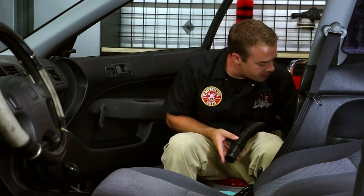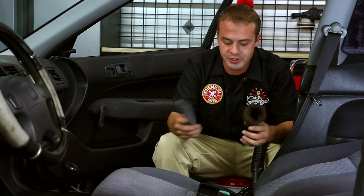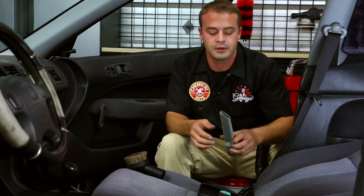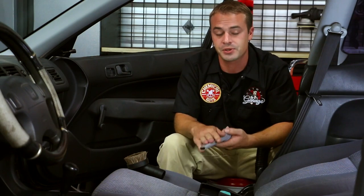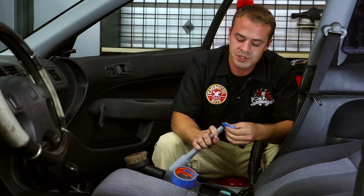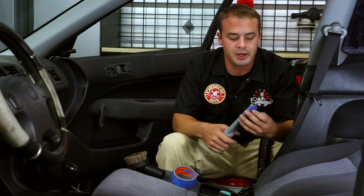When it comes to vacuuming, normal vacuums come with a bunch of different tools: your pointy end tool, your brush hair tool, your wide angle tool. Each of them has a specific purpose and a specific job. This one is for getting into tighter areas. A little tip: if you're a little OCD and really want to get into tight spaces, these small pointy extensions can be made even more precise. You can take some painter's tape or detailing tape and tape over the little section to give you a fine point for suction, really helping you get into hard-to-reach areas like inside your door panels and handles.